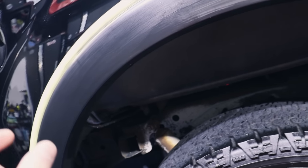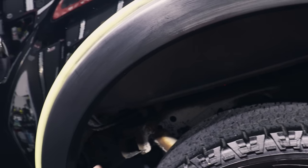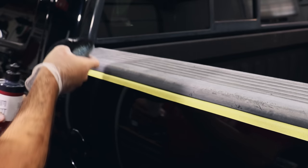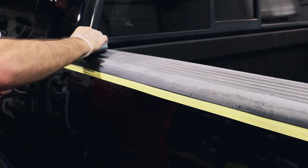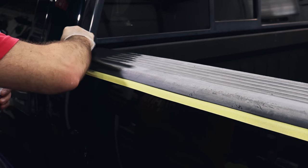This paint dries very very quickly and you basically have to apply it as evenly as you can and then leave it alone. If it's still a little streaky you can go back over it with the paint, and then you can actually coat over this or use another type of dressing to even it out. I have to work fast — I'm just using a little applicator here. Use whatever applicator works best for you and move quickly, getting it on as evenly as you can without leaving any heavy spots or blotches.